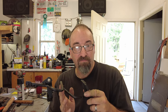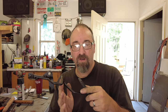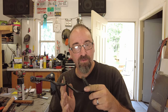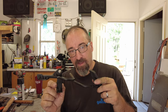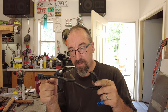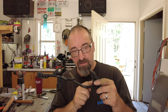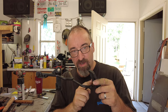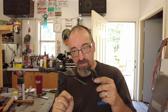I went into a couple of our vehicles and measured how much the pedal deflects, and they were all right around two and a quarter to two and a half inches. So I did the math and translated that: two and a quarter to two and a half inches of travel at the pedal position would equal seven-eighths of an inch of cable pull at the Cummins linkage point.